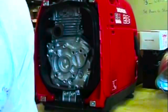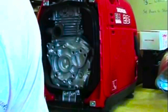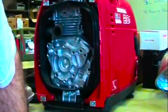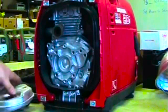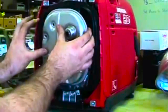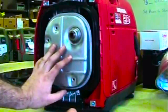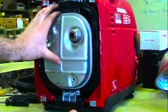It's just like a window screen. You need to clean it off with a brush or use some carburetor cleaner, and make sure that it's clean and the exhaust gases can move freely through it. Once you clean it, slide it back in and bolt it down to the engine. If you do decide to remove it permanently, that's not recommended — especially if you're running your generator inside.